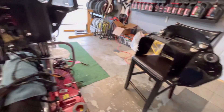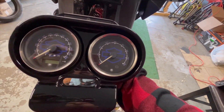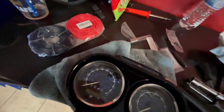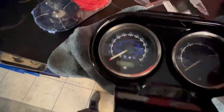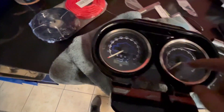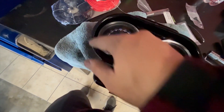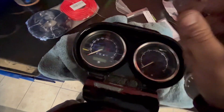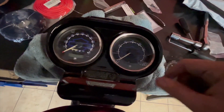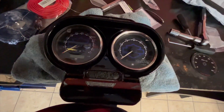I went ahead and changed the faces. What I did was I changed the old faces — the RPMs — and put the new ones on there. It's pretty simple. You have to be careful with taking that needle out; you don't want to bend anything. Taking this rim, you're going to have to kind of pry it open all the way, go around the rim on the backside, pry it open as much as you can, and then pull it out. Then you access the needle and pull it out nice and smooth.